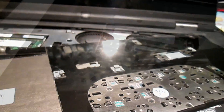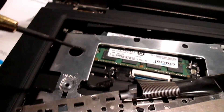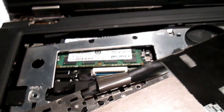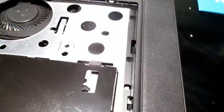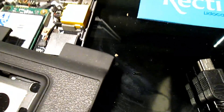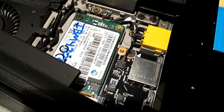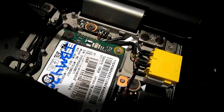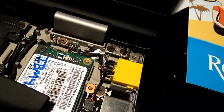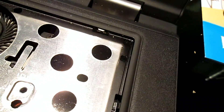You can unplug that front light cable with a fingernail or screwdriver - fingernail is fine. Just unplug it until it releases from the socket, and that gives you enough room to pull up the metal tray without damaging the other connections. Rotate it out of the way to access the hard drive installation space. I've already got the SSD installed here - I plugged it in and used one of the back metal screen screws to secure it with the little pin on the right.